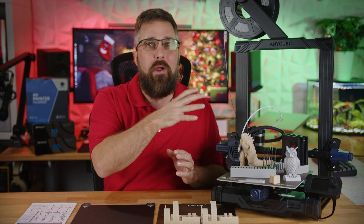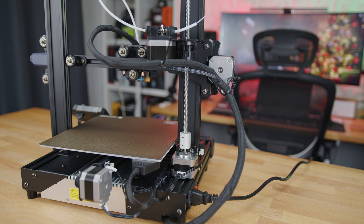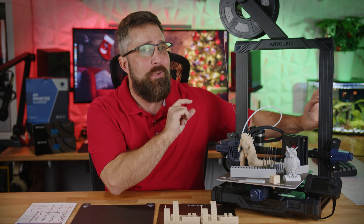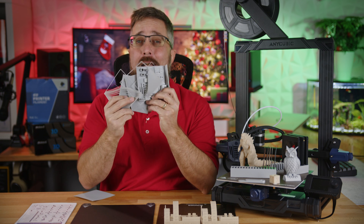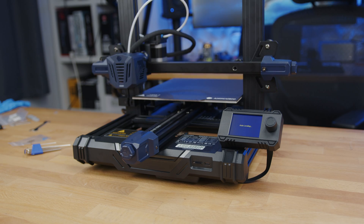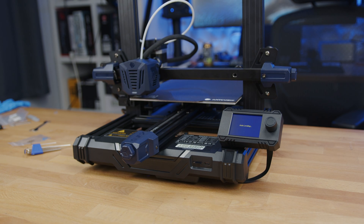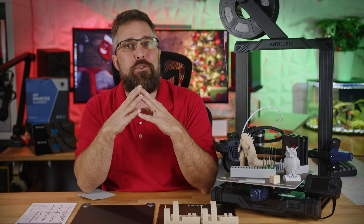In adjusting the printer, I noticed a problem with the single Z-axis motor and drive. It just wasn't cutting it when it came to moving the gantry arm evenly on both sides. I found that if I tightened the V-wheels on the right side just a tiny bit too much, they would get stuck, but if I loosened them slightly, it would sag. It took a few tries to find the right balance. The difference is probably less than half a millimeter, but the auto-leveling process doesn't seem to take that into account — in fact, it looks like it actually overcompensates, because the movement along the Z-axis is greater during the leveling process than when it's printing single layers. It's a frustrating issue that took a while to iron out.